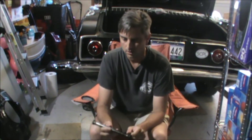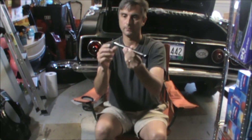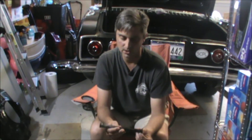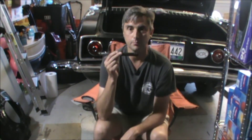I touched on this briefly when we were doing the head removal a couple videos ago, but it's an important topic worthy of a little more explanation. Like most cars of the time period, the Corvair's valves are activated by pushrods, and those pushrods have to go through a void between the block and the head — unlike a pushrod V8. These tubes carry the pushrods within them, acting like a bridge of sorts. Oil passes through them also, and GM put rubber O-rings on both ends. Part of the problem is that over time the engine heat just absolutely cooks those rubber seals. They crack and fall apart, and as such the pushrods are one of the major sources of oil leaks on Corvair engines.